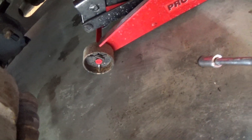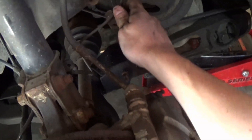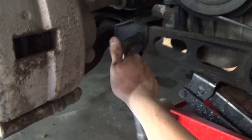I jacked the car up, took the wheel off, and jacked up on the oil pan a little bit. Now we're going to go ahead and replace this lower mount, then move back up to those bolts. If we have to adjust the jack to get things lined up, we can. That bolt was a little tight but it worked — a little bit rusty but nothing that big Bertha won't take care of.